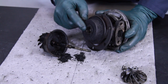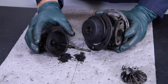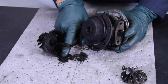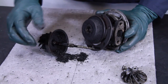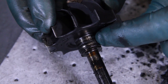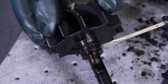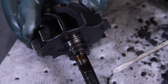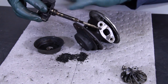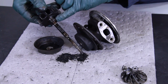What's happened here is the oil leaking by the sealing ring, with that high intense heat from the exhaust, is just causing it to turn to coke. This stuff gets hard, and two things have happened: one, it has worn out — look at that, cutting into the metal here on the turbine wheel shaft. The sealing ring is broken — I'm sure that's caused by carbon contamination in the ring.